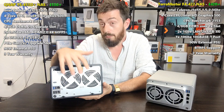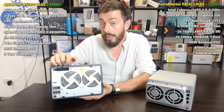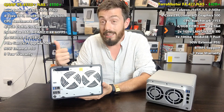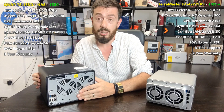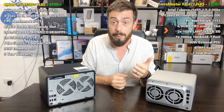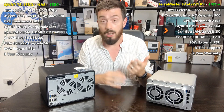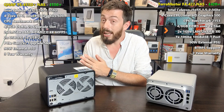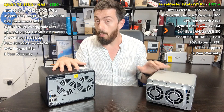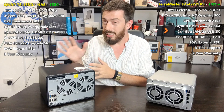The QNAP also features a single large fan and a PCIe Gen 2 x2 slot, allowing you to install 10GbE network cards, M.2 NVMe cache cards, or the QM2-series SSD cards as raw storage. There's even a combined QNAP card with both NVMe SSD and 10GbE on one card — usable for raw storage, caching, and all over 10GbE. That costs roughly an extra £200, so while it widens the price gap, QNAP doesn't remove 10GbE from the table — it just makes you pay extra for it.